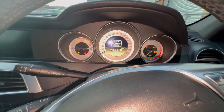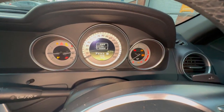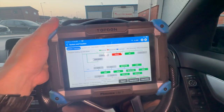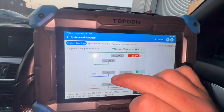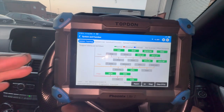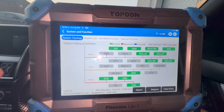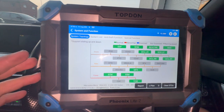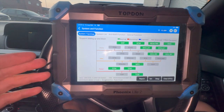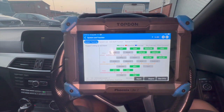We've just got back from a decent road test — about 12 miles — and it drove absolutely spot on with no issues at all. Starting it up, you can see there's no engine warning light now. We've done a full code scan with the top-end diagnostic machine and it's nice and clear in the engine control module. There are some other issues in other ECUs but the engine ECU is clear, so it's definitely fixed the fault. I'd definitely recommend fitting a genuine Mercedes sensor rather than aftermarket — we've had a Bosch one before that we just couldn't get rid of the fault with. Genuine Mercedes, fitted and calibrated properly, sorts the problem out. Hope you like the video — give it a thumbs up, subscribe to the channel, thanks for watching!